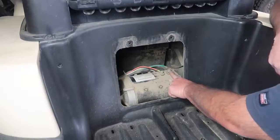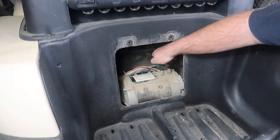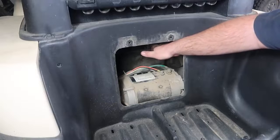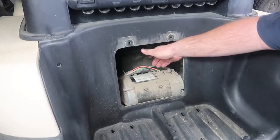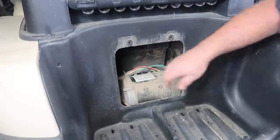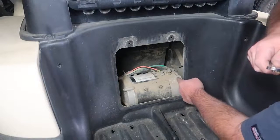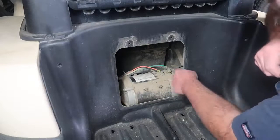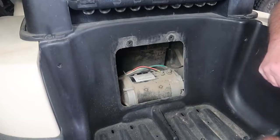This is a 1/2 inch. There's going to be a green and a white wire. Both of those are 1/2 inch. The white wire is actually on the front of the motor. The orange, and there's a blue wire, are 7/16 of an inch. The blue wire is on the front of the motor. And then on the passenger side of the motor here is a speed sensor. And you can see it back in that corner there as a harness when we need to disconnect that.